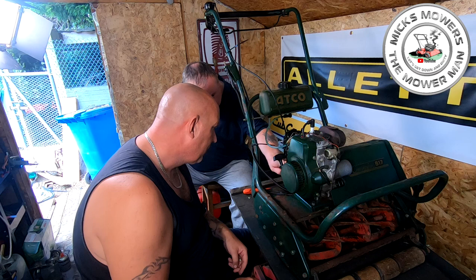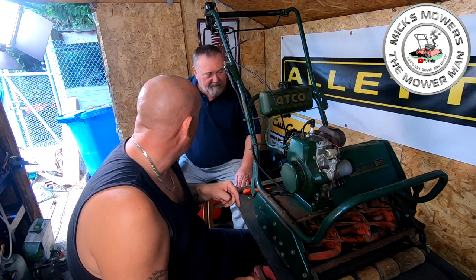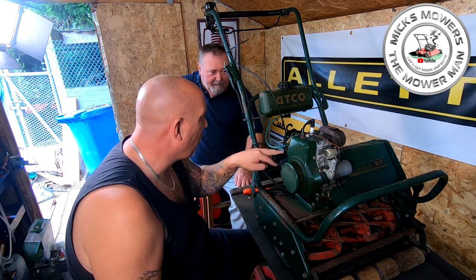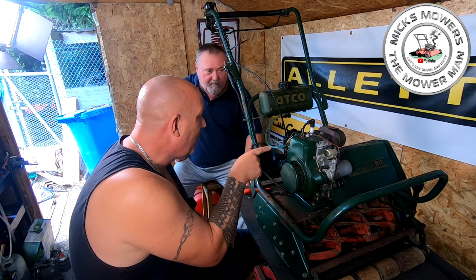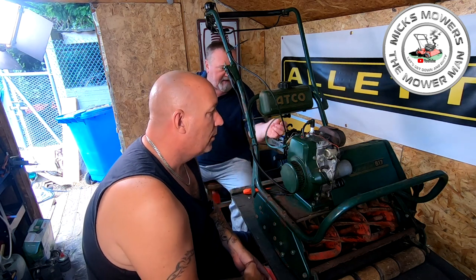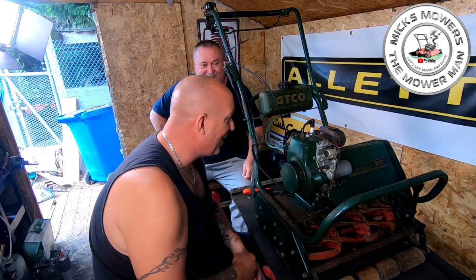Because there's a drain screw at the bottom of the carb. Up here, mate. So what you do is you turn your fuel tap off. You then drain your carb, so there's no fuel in there at all now. And then with your screw left out, you can then turn your fuel on. The fuel comes down. Once you get fuel into the bowl, you then do the screw up, and it just fills up with no air bubble. Yeah, because this line only just fits onto the tap there.